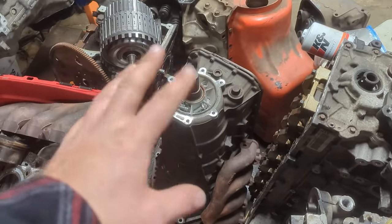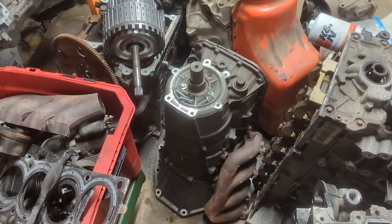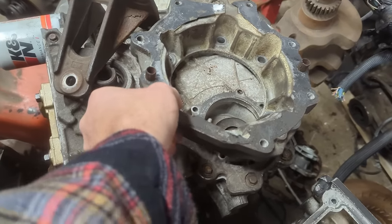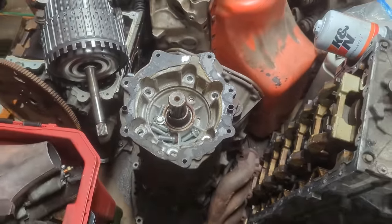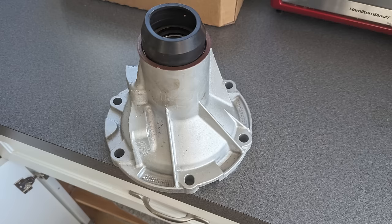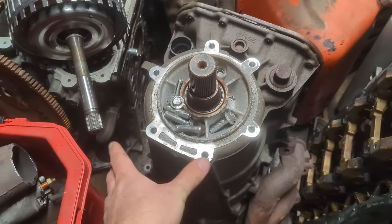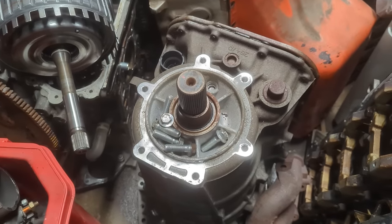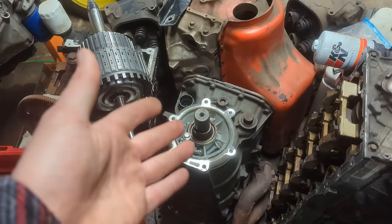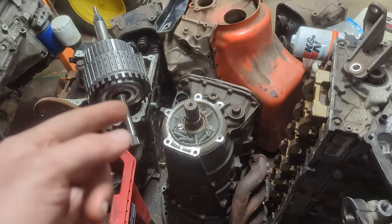The problem with this one in particular is it probably has some weird Cadillac ECU, so I would have to change that out to one from another vehicle that is easier to tune. Also, this is a four wheel drive transmission with a little adapter plate for the transfer case. I bought a 6L80E tail housing to convert it to two wheel drive, but the bolt pattern was way too wide and none of the bolts lined up. So since I wanted to get this project moving, we decided to go a different direction and adapt it to a turbo 400.